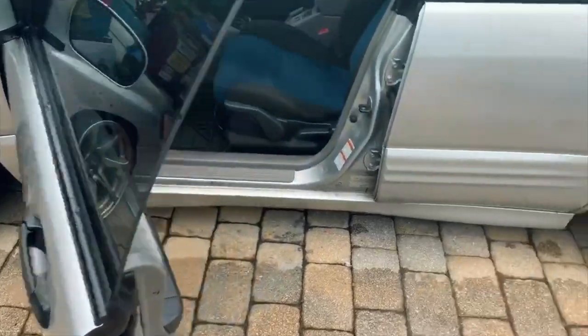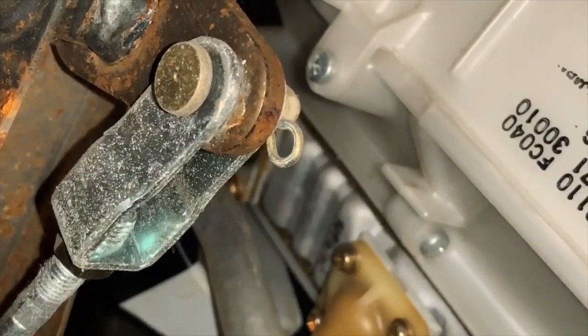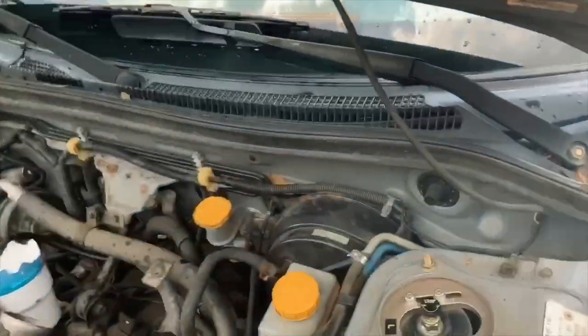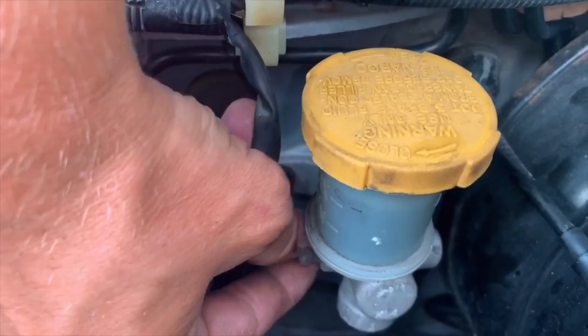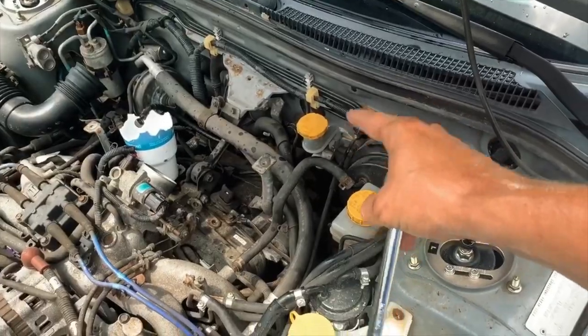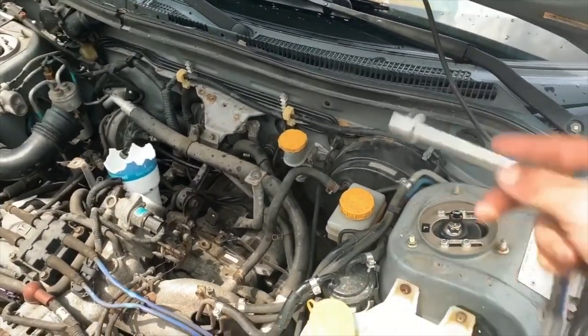Sun is out and the rain has stopped. Underneath here the clutch pedal is connected up top - there's a pin on that side to pull out to disconnect it and it should slide right off. Just took off the pin on the other side. We've got this hydraulic line - grab a brake line wrench and both sides are 12mm. You might want to take out the brake fluid first so you don't get a bunch of leaking. It should just pop right off, and putting it back is the exact same process.